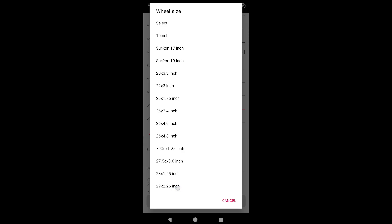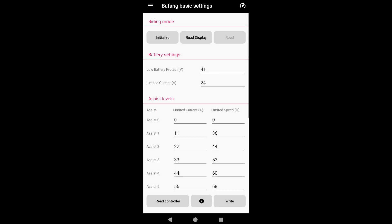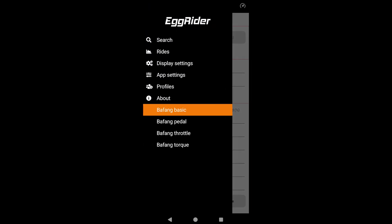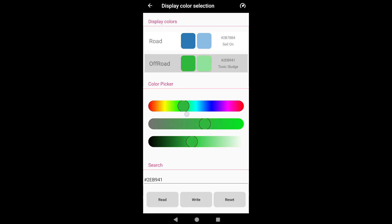A link should appear on screen now and also in the video description below. Even though I have 2 batteries of the same size, I want to set all three fields to 36V. Please spend some time to properly set your battery specs. Now let me write the display settings and we're done. In the Bafang basic settings, I will simply initialize the settings to make sure the display loads my controller values. You can use this section and all other Bafang-related tabs to reprogram your motor, just like you would with the Bafang configuration tool on PC. Another cool feature specific to the C1 colorful display is the ability to edit the color palettes for the 2 riding modes, letting you personalize your experience even more. And this is the result.